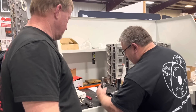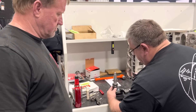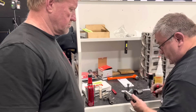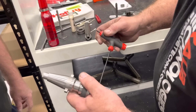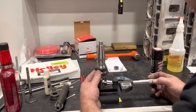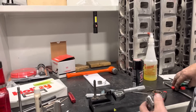Already preset it, but you set it to the gauge — just to let you guys see, I'll loosen it up and roll it in. We're a little tight, we're at 1.661, so I need to open this thing up about six, seven thousandths. I take my allen wrench, put a little press on it, turn it out. Here's the cutter moving in and out. I back it up and check — I'm at 1.671, a little too big. It doesn't take much to adjust a couple thousandths.